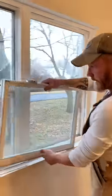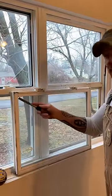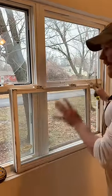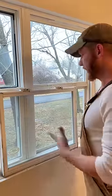Can you see this? And then, Jason, with your razor blade — you've got to come in here after you got that fan out, and you cut all the silicone out of here, and that glass will pop all the way around. You'll know when you cut it out — you'll feel it, and then that glass will pop right out. But you can leave it in until your replacement glass comes in. That's it.